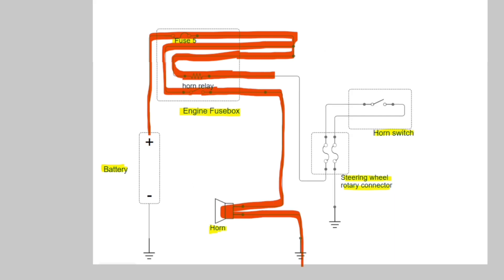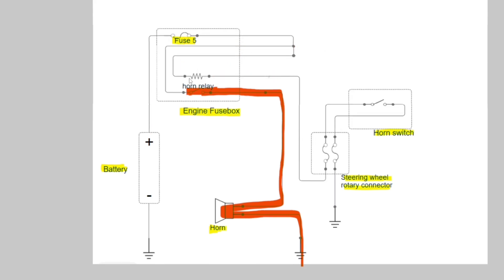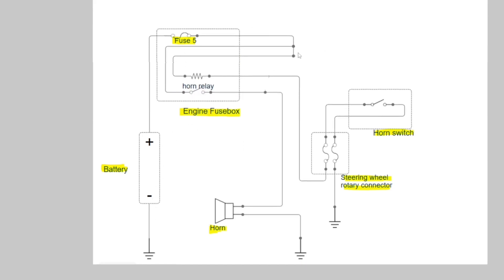As you can see, we have completed the circuit and your horn is working. There is no problem in the circuit. But if your horn is not working, you need to diagnose the wiring diagram and identify the faulty part. Maybe the wire going from a point is broken, maybe you have a ground problem, or — most commonly — your fuse is blown. Check your fuse first.